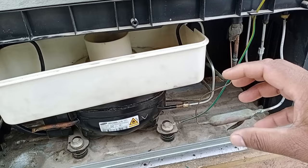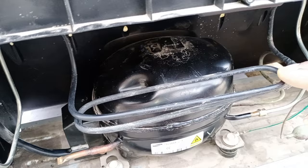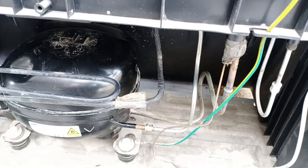Now let me explain the problem by removing this tray from the compressor. After removing the tray, this pipe has a cover on top — you can see the metal pipe here, and the rest of the tube is covered with heat shrink. This pipe area seems to be damaged, and the leak seems to be in this area. I cleaned this pipe and saw traces of oil here; the tray also had oil inside it. As the pipe is leaking, it's possible that water could have gone inside the refrigeration system.